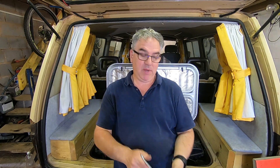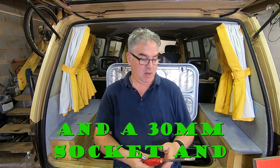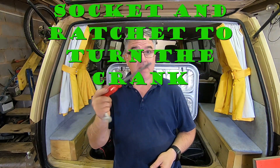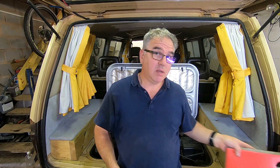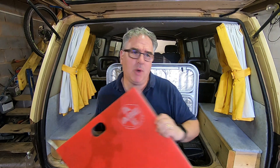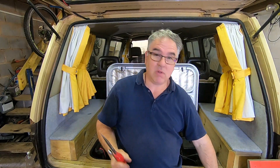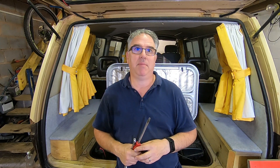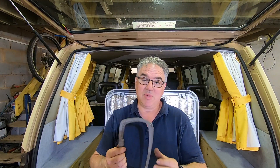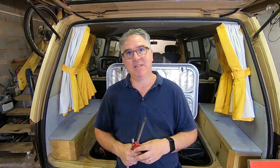The tools you're going to need for today are a 15mm spanner — combination or ring, doesn't matter — a nice screwdriver, probably your favourite flatted screwdriver. Something to lie on, because I'm old. Some rags to clean up, and if you've got some, some gloves and a good light. You will also need two rocker cover gaskets, nice new ones. Okay, let's crack on.